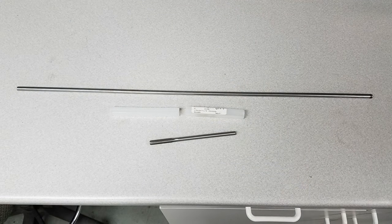I've done something different with dowel pins than what most people do. The SA Designs book shows Gene Mooneyham, a very well respected professional blower builder, opening up dowel pin holes to the next standard size which is 3/8 of an inch. This is certainly the way to go for professionals that must turn out work quickly. I didn't like the idea of opening the dowel holes so far in case I made a mistake or if I had to change an end plate in the future, so I elected to do a custom size slightly oversized pin.